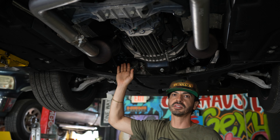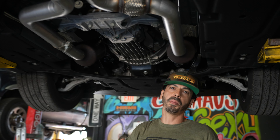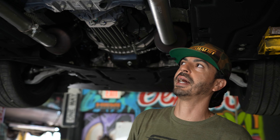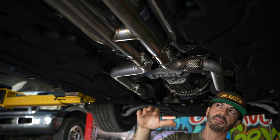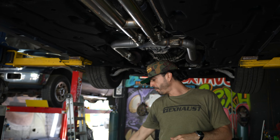If you're pulling up to your exhaust shop, don't look like a dumbass — we're here to school you. The exhaust usually starts with a set of headers, then comes down to a set of catalytic converters. Usually you don't bypass the cats, but if you do, long-tube headers come with a set of high-flow cats. After that, if you want to upgrade your full exhaust, it's called the cat-back — usually starts from there all the way back, with some kind of resonator.